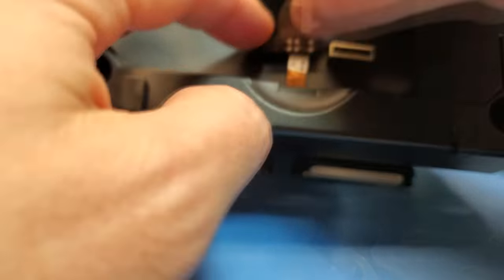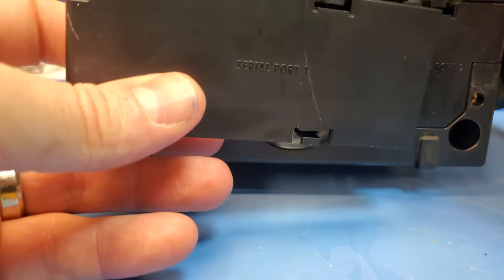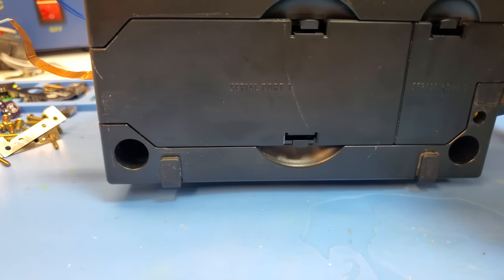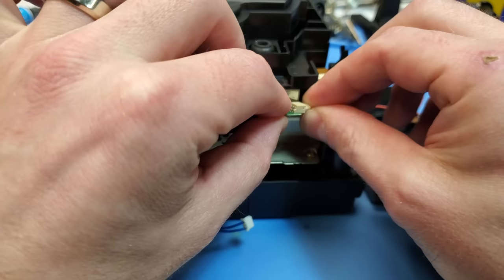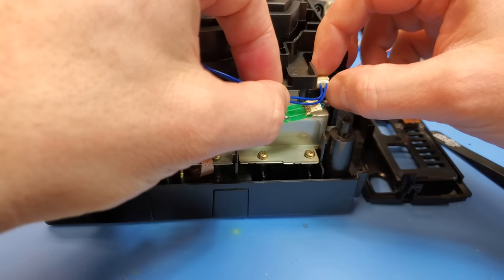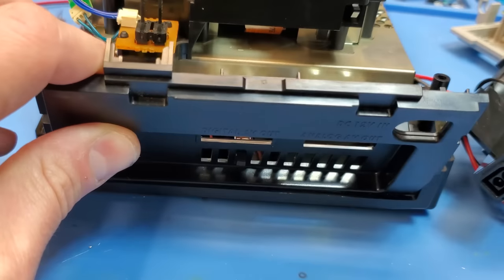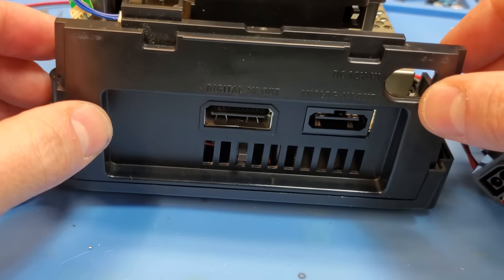Most people install the USB adapter into the Game Boy Advance player port, but I want to keep that available, so I'm going to install it into serial port 1. It's a little extra work for the cable routing but worth it. The last step is connecting the mod chip to the wiring harness and then hooking it up to the DVD drive, which allows the mod chip to control the open/close status. Then it's just reassembly the way we took it apart.